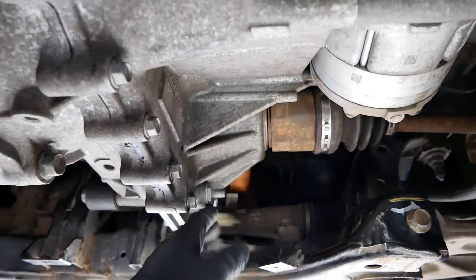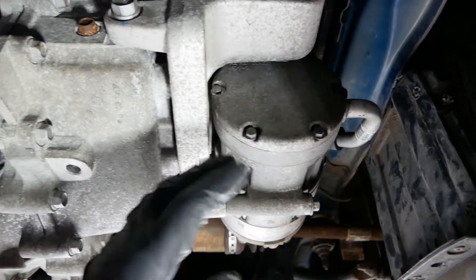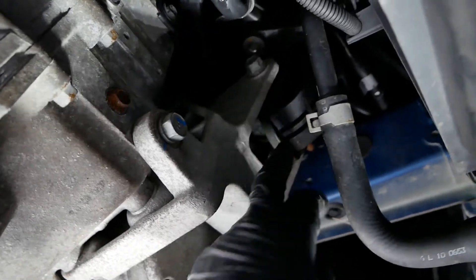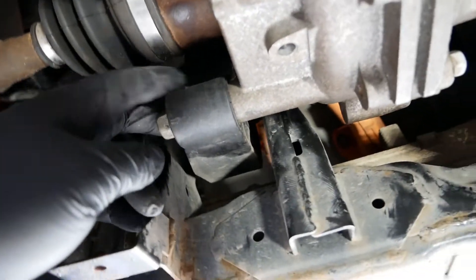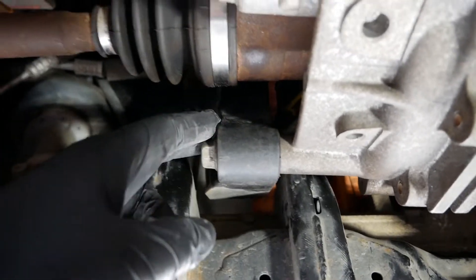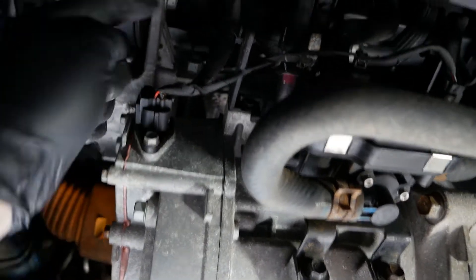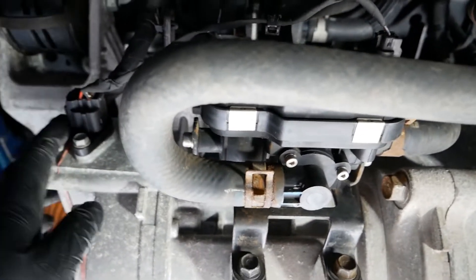In here is the differential as well, and there's the air conditioning compressor bolted onto the side of the electric motor. This whole lump has a bracket with a rubber mounting — like an engine mount — and there are three mounts total which mount this whole engine stack. Then on top of the motor, which we'll look at from the top, is the charger, inverter, and all the other electronics.